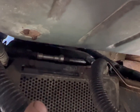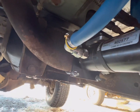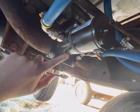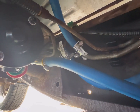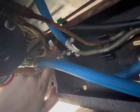As you can see the fuel cooler is remounted — got our bolt up here, one here, and one down here. I'm going to zoom out and show you what I've got going on with the FAST. Here's the FAST, here are your 13 millimeter bolts holding it on to the cross member. Weep hole is down as mentioned. Here is your outlet that goes to the engine. There's a nice section right here in the frame that kicks down, so I went ahead and bought that pipe cutter and cut it. Here's your suction coming out of the FAST outlet side — up goes to the stainless line running to the engine, and the bottom one is your suction drawing from the fuel tank.